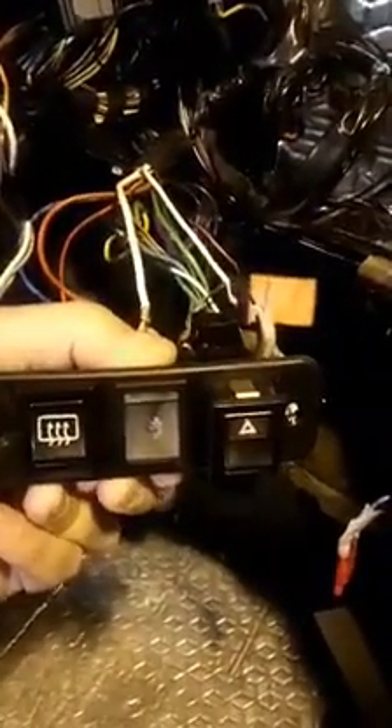Things to look out for: you'll have three switches down here — demist, fog, could be interior light depending on what you've got, and hazard. They just need snipping and the wires need feeding across into the center. We rewire them onto new switches in the middle, extending across and putting into new Carling switches — they're usually pretty nice, chunky switches. So those need rewiring across.